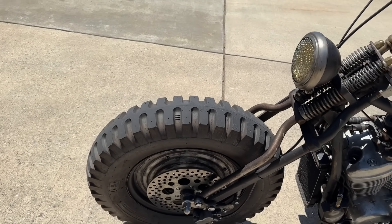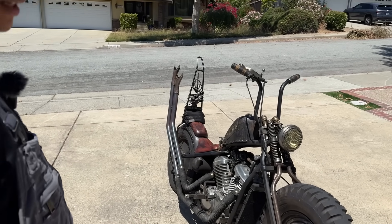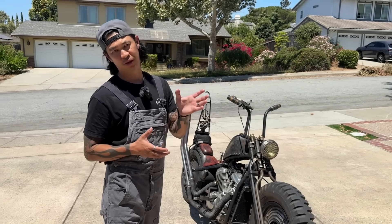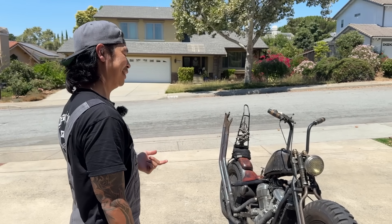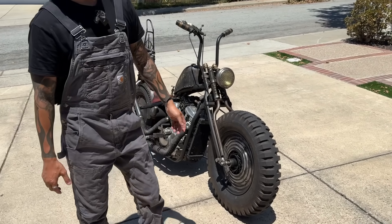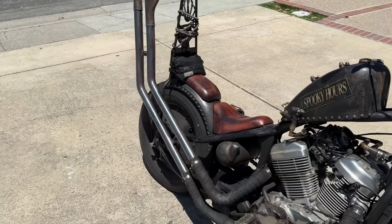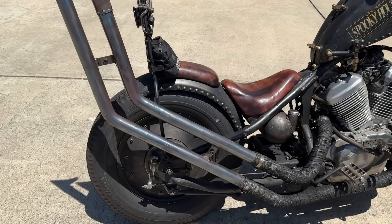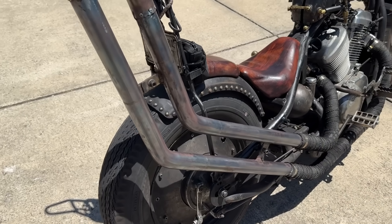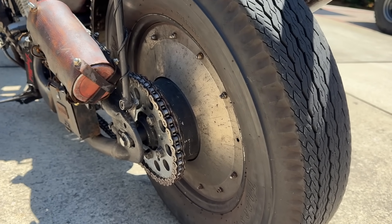It was only $85 which is pretty cheap. Are you planning to do the same for the rear? Yeah, that's in the works — I got parts ordered. I got the 16-inch wheel because they only come in 16-inch, and the rear is 15-inch so it's not gonna work. I'm taking the wheel from my shovelhead and slapping that over. Got the axle, and I gotta space out the sprocket because it's not gonna line up. Now I'm waiting on Sprocket Specialist to make a custom sprocket.